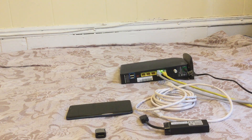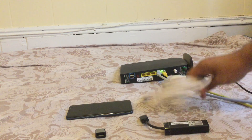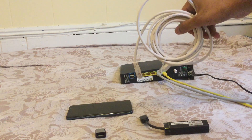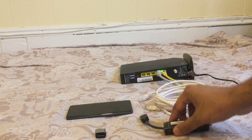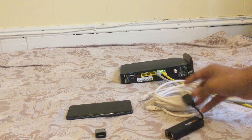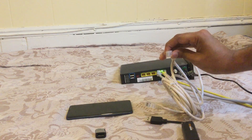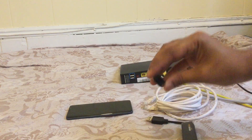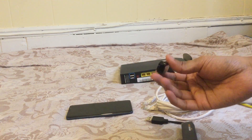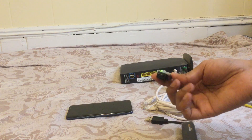Hello everyone, today I will show you how to connect ethernet on your phone so you can use ethernet instead of mobile data or Wi-Fi. For this you definitely need a router, a landline cable — I used Cat5e — and a USB3 to gigabit ethernet adapter. This end is the gigabit ethernet connector for the RJ45, and from USB3 to a USB-C connector to connect your phone. My phone's port is USB-C, so I bought USB-C; you can buy other USB types if your phone supports them.